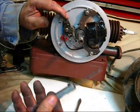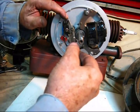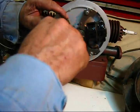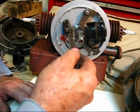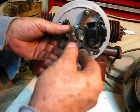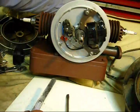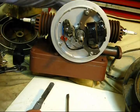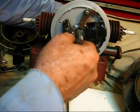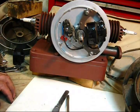On the get-go, if you're not familiar with 20 thousandths, just familiarize yourself with where 20 thousandths is, and you can use that as the initial setting. Put the feeler gauge back in there — that's pretty good, I'm going to leave that as is. There is a little bit of resistance. Check it again — actually, the best thing to do is to come around and check it. That's 20 thousandths — being honest, that's about 19 thousandths. That is good.